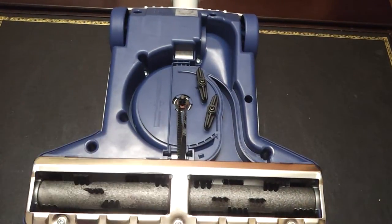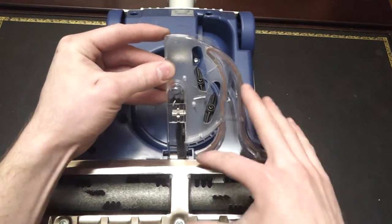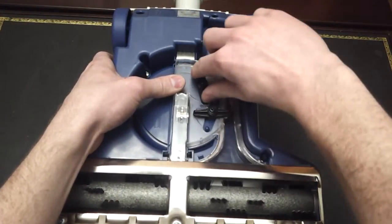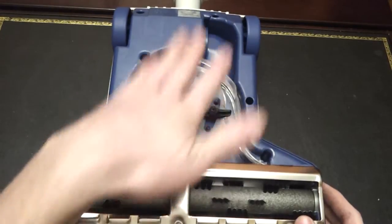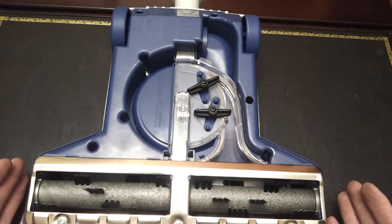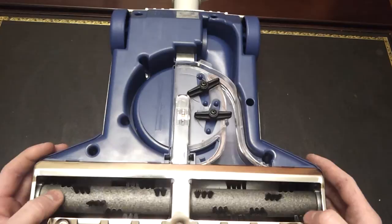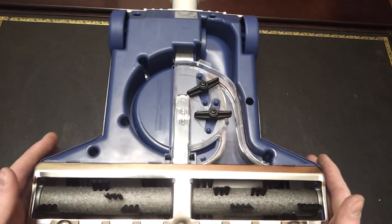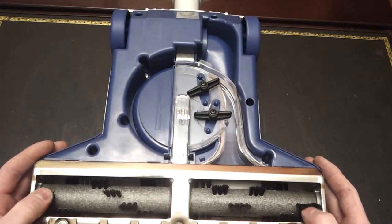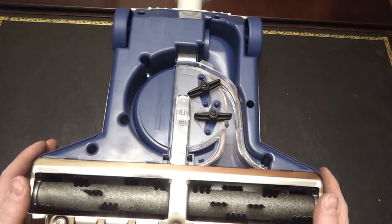To put the top cover on, hook the flared lip of it underneath the metal plate, then press the back down as you turn the latches. Make sure it goes under the plate — if it sits on top, you won't get a suction seal and the brush won't work well. At this point everything is back together and should be working. It should spin with a lot of speed, though that does depend on the suction of your central vac unit. If it's still not spinning well after servicing, you may want to check the unit itself. That's all for now — thank you for watching.